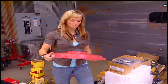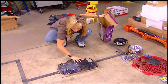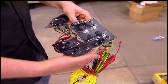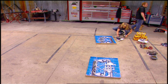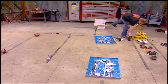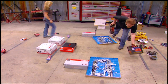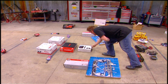The layout begins: headlights up front and a fan for the radiator, plus two off-road lights on the bush guard, a trans cooler with a built-in fan. A lot of accessories means a lot of power needed, so a dual battery kit. The fuse block will be mounted behind the dash, plus gauges and switch panels, a GPS unit, power windows in each door, switch panels to control everything, roof-mounted off-road lights, tail lights, and the 7-pin connector for the trailer. And all work and no play is no fun — so speakers for each door, subs in the rear, an amp for the subs, a backup camera and DVD player, three TV screens, and a video game console.